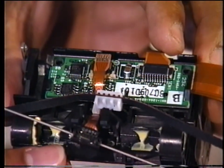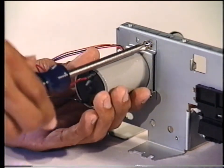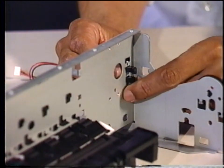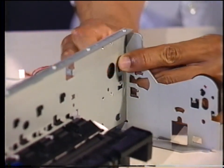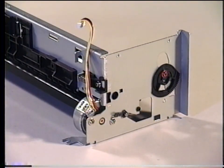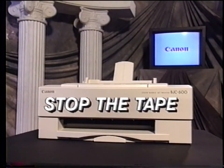To remove the home position sensor, first remove the screws holding the carriage motor. Release the latches from the front of the printer that hold the home position sensor and remove. To remove the paper feed motor, remove these two screws and carefully release the motor from the gears. Now prepare to stop the tape — remove the carriage unit, the linear encoder, and MR head assembly. You should also remove the platen, paper feed roller, and motors. We will continue the video with printer assembly. Now stop the tape.